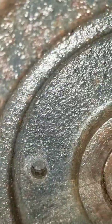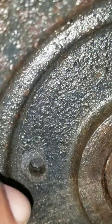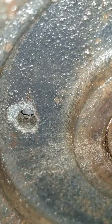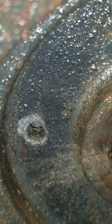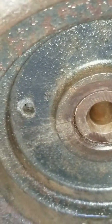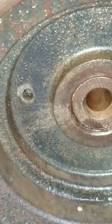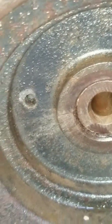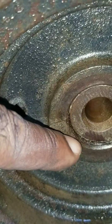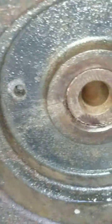When we take a close look at that bolt, this hole right here — what's going to happen is the threads are going to become corroded, and when you install your pulley tool you're most likely going to bust that thread out of that hole, which will now prevent the pulley from removal. The pulley will become excessively stuck because in this area here where the pulley is fitted to the snout will become corroded.